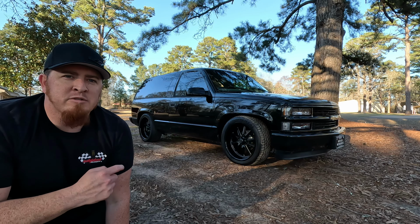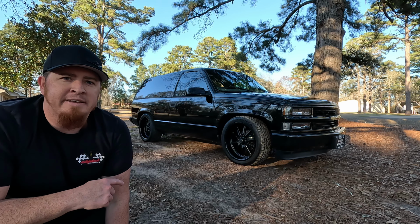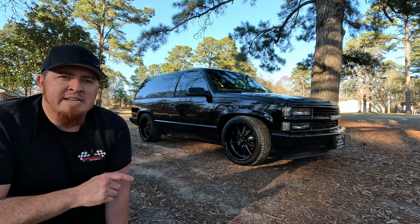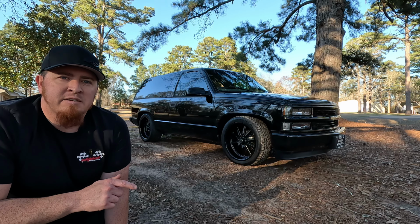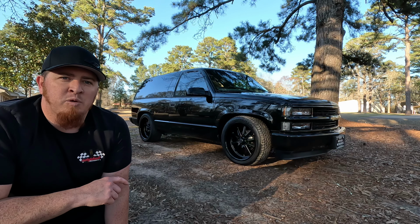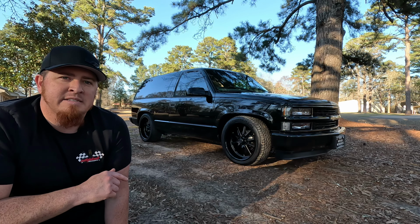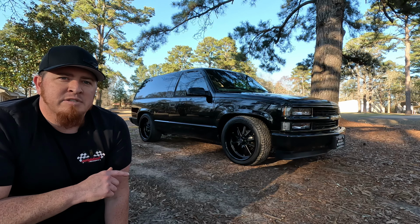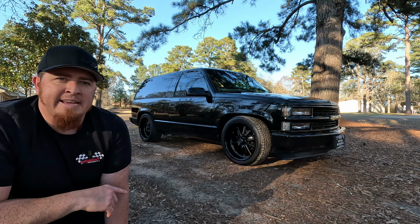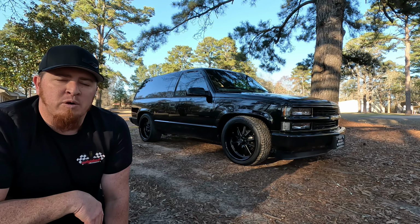I had these 20-inch wheels wrapped in Continental ExtremeContact DWS 06 Plus tires in the 275/40/20 size. I compared these Continental tires to the Nitto 420V tires, and a couple things y'all might find interesting. These tires have a 50,000 mile warranty where the Nittos do not. Also, these Continentals in the exact same size as the Nittos are 7 pounds lighter per tire. So you're talking 28 pounds of rotating weight less than the Nittos. So to me, it's a no-brainer, and they're worth the extra money.